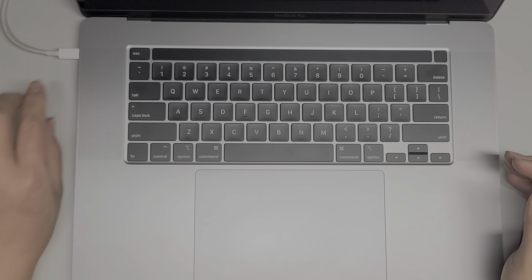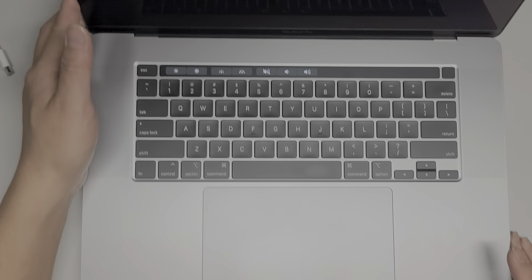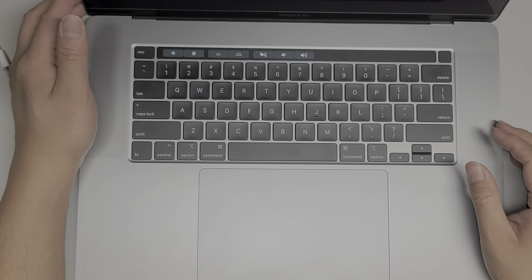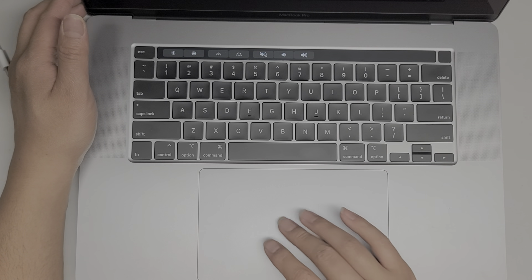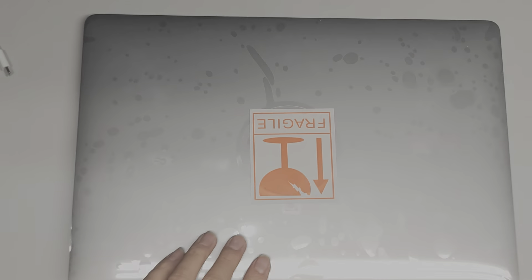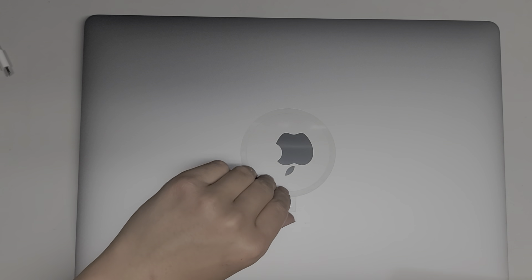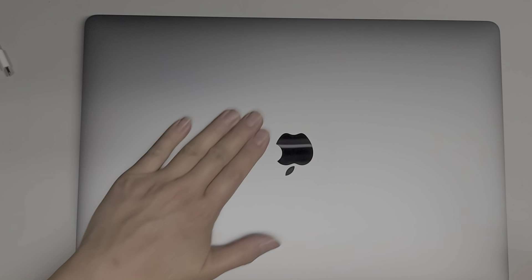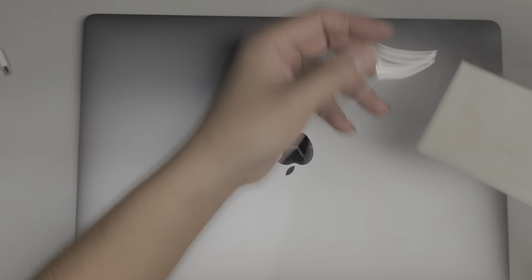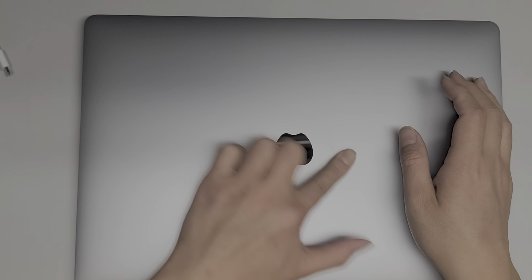So that's pretty much it — we're going to just put back the screws. Make sure to also test: unplug it and make sure it stays on, so it is staying on. We're good to go. I'm going to go ahead and put back the rest of the screws and then peel off the other protective coating. I'm going to close this and peel this off so we can see this nice new bezel. I'll use some rubbing alcohol to get that little circular mark out from the suction cup. Just get some rubbing alcohol on a piece of paper towel and you can clean it off — and the circle's gone.